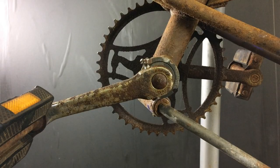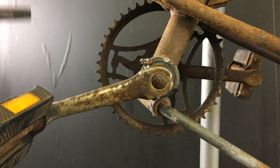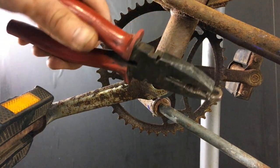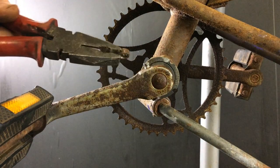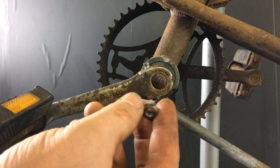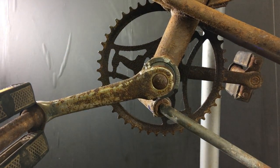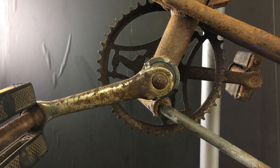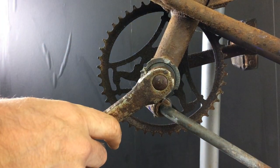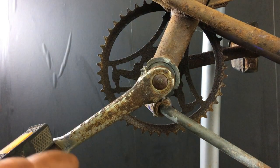I'm not sure how much you guys want to see — you might need to put comments in below. I ended up having to cut the nut off because the threads are totally shot on the bolt and nut. The pin is pretty well chewed up as well now. Some of you might say I've gone too far, but I do need to get this off — it's been soaking for about three weeks. Sometimes it's just sacrificed. You can still get a new pin for it, I've seen them, just would have preferred not to.